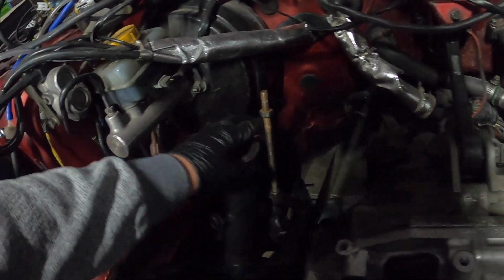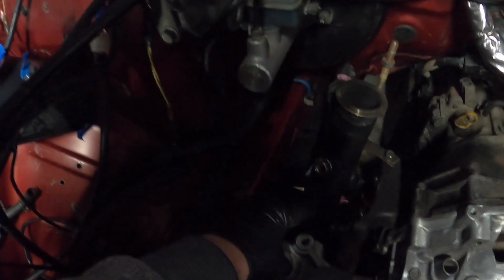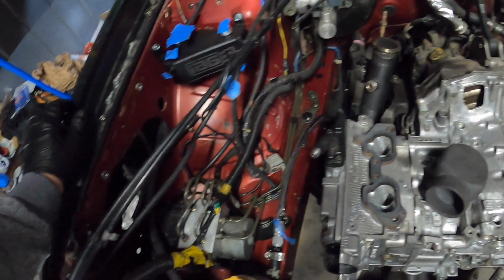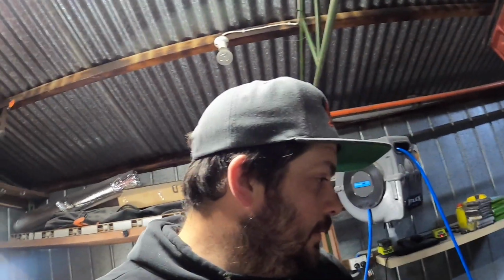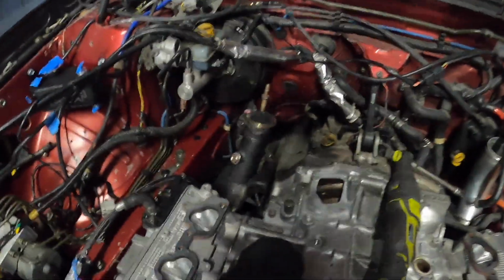Yeah, that up pipe's not connected, so the main thing with this up pipe is we have to work out the power steering lines. So I'll probably have to get in there with just that bolted up, see what the go is with the power steering lines, and see where I can put a wastegate. Might have to go down on the steering and back around and up to go back into the dump of the TD05, so then it can feed the GT35. It's going to be a bit of piping back there, so yeah, it's going to be obviously all heat wrapped, to keep the temps down, hopefully, around that area.